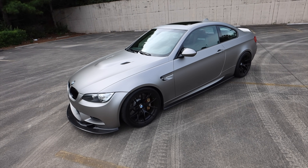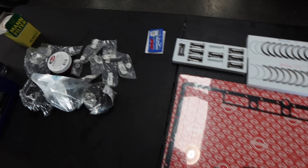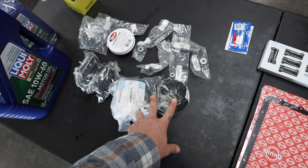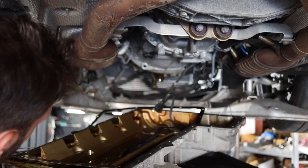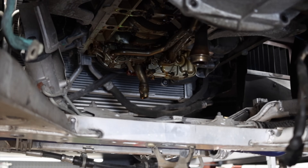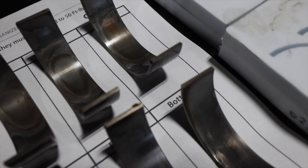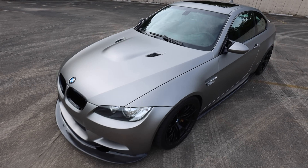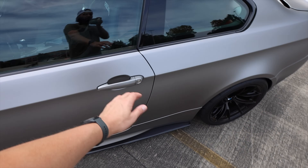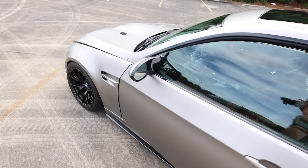One of the other things I took care of were, obviously, my rod bearings. I went with an oversized rod bearing replacement kit — I have all this stuff linked down below. Even though some people say they've done them, if there's no proof of it, I'm going to go ahead and just do it anyway. I'd rather be safe than sorry. I do intend on keeping this car and driving it hard, and I don't want to risk this motor. I have not done throttle actuators in this car yet, however I am going to do them — that is just something that is inevitably going to go out.